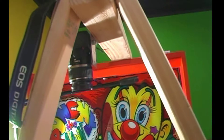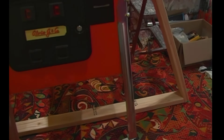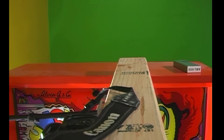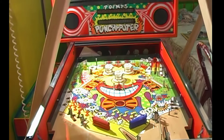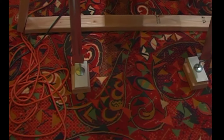The wood framing is sort of a triangle that goes all the way down and across, which stabilizes it from going back and forth. It actually attaches to the machine at the top of the cabinet with a couple of screws. Notice it's not in the center — it's moved over so that the camera is in a nice spot and shoots straight down on the playfield without being off-center. Down here you can see the lifts that level the game — if the playfield is not level, stuff rolls around.